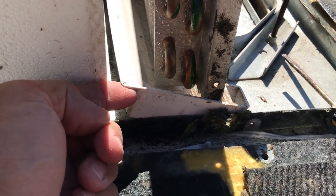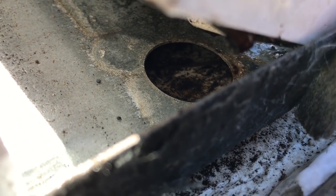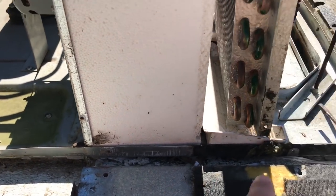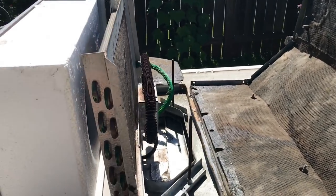And if those get clogged up, it's a no-go. It will literally just back up and go right into your camper — it's a real problem. Check it out. See the tray? It has a little bitty drain hole underneath it that allows the water to come out through here and just drain down wherever it's got to go. In my case, I had like four dirt daubers and three wasps and some fabric from the filter that built up over the years and dust that clogged it up.